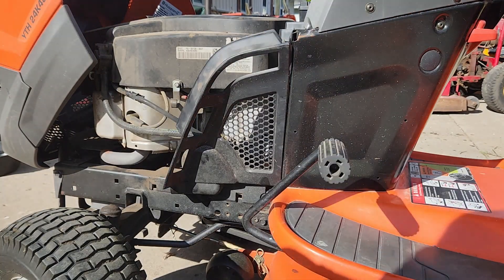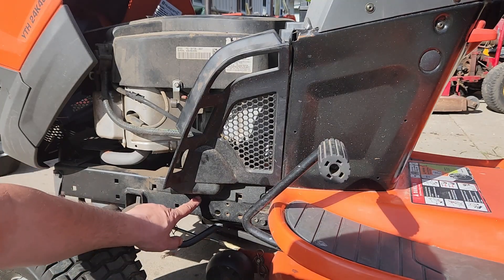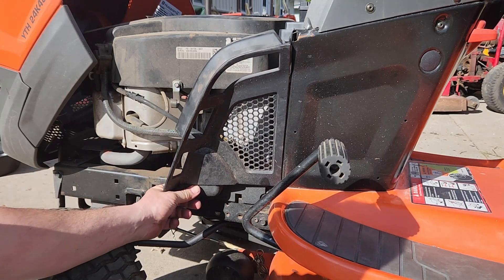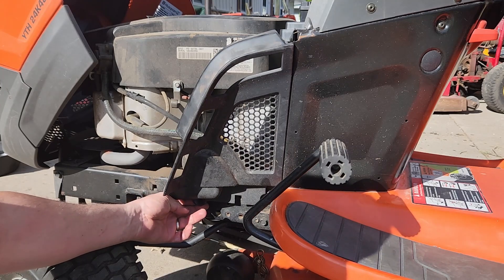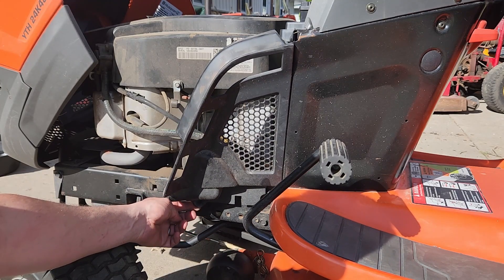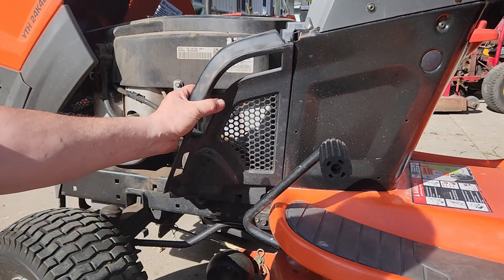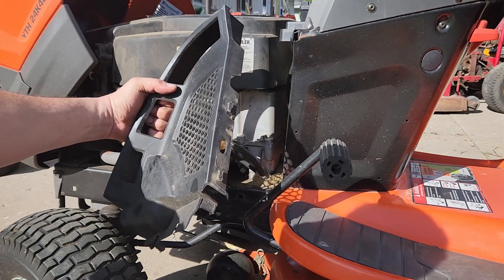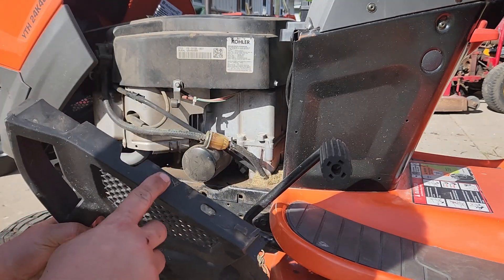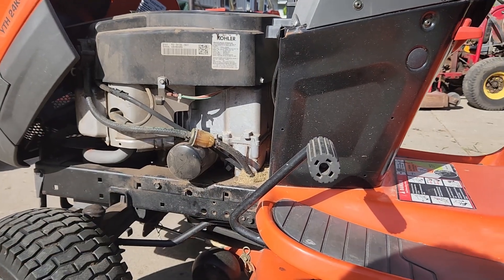In order to access that, down here underneath is a plastic plug that holds this piece in place. If you gently pull it away, sometimes the plug will pop out of the hole, other times the plug will stay in place but the plastic will come loose. Once that's loose, what you're going to do is lift this up like that — it slides out of place because these squared-off or rectangular notches sit in a groove over here.